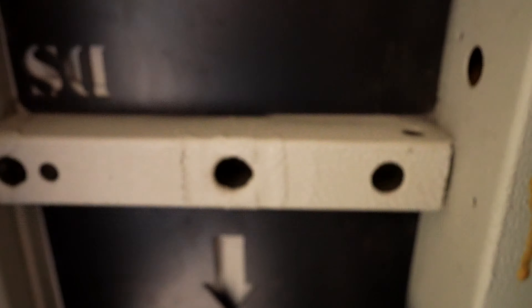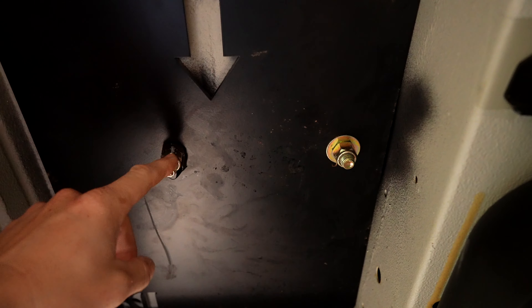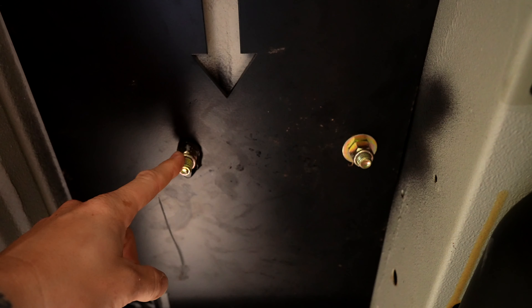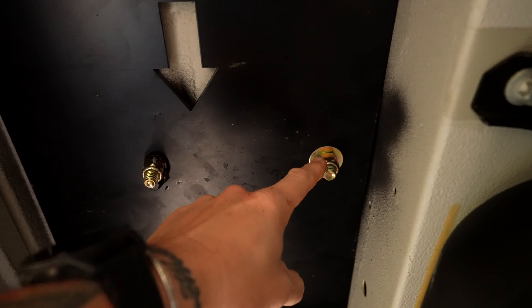It's only four bolts and it pinches the pinch welds underneath. We're going to go under the van in a minute and I'll show you exactly how to install the base plate. It's a half-inch drill bit, super simple. Here's your base plate — you've got four bolts, two on the front and two on the back: two towards the front of the vehicle, two towards the rear of the van, and these bolt directly through your floor and directly through the van.